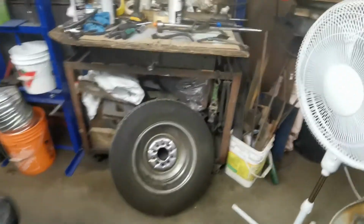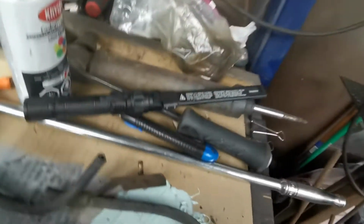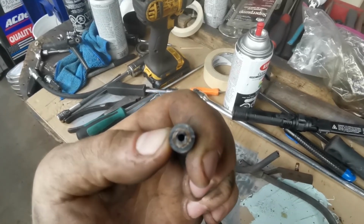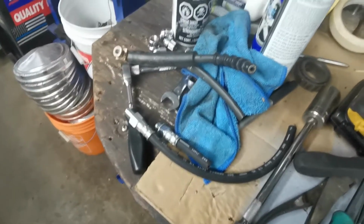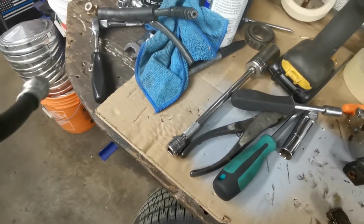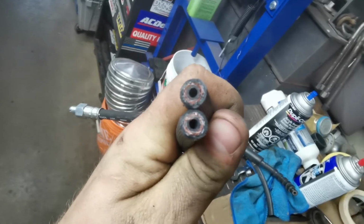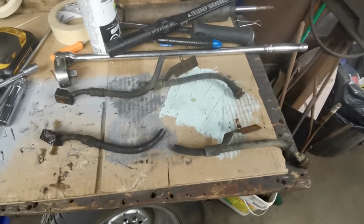So I did what any good mechanic would do. I confirmed my repair. I took my brake hoses here and I cut them to have a quick look. And it's hard to tell, but that orifice there is definitely smaller than it should be, because I sacrificed a couple old brake hoses I had here. I bought these and they showed up and they were the wrong ones, actually. So for the cost of a brake hose, that's what the orifice should look like. So what happens over time is they internally collapse. So a set of brake hoses should do us wonders.